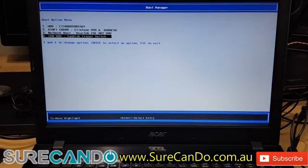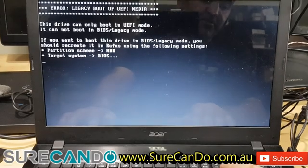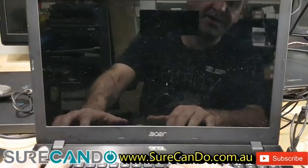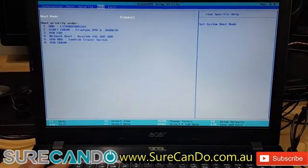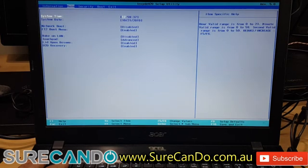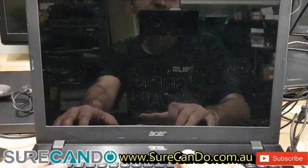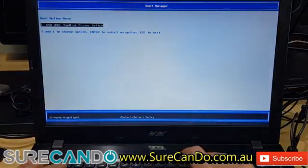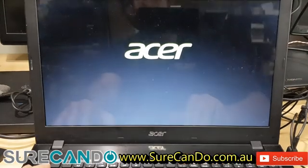And boot from the USB. Oh, okay. Can only boot in UEFI mode. Okay, cool. Let's go back into BIOS. This USB was made in UEFI mode to boot from, so we're going to change default boot to UEFI. F12 boot menu enabled, and F10, and then F12 again. And now we shall see the Windows 10 boot screen.